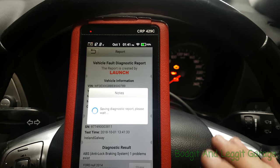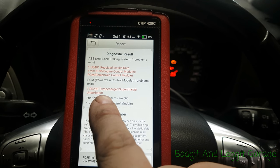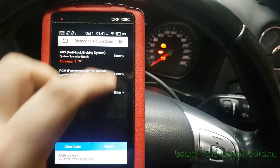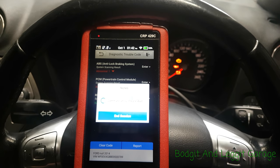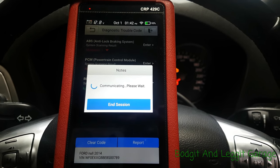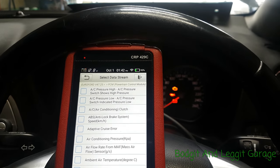As you can see, we've got a fault in the ABS. I'm not worried about that yet — it saves the result which is really nice. The fault code I'm more interested in is P0299: turbo/supercharger under-boosting. So we're going to go OK with that and go into that module, and then into live data to see what data streams we can actually get on this.